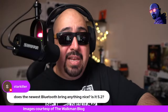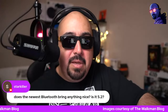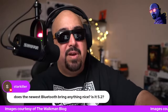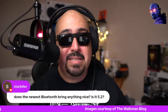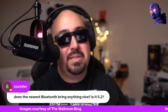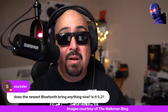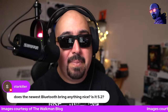Does the newest Bluetooth bring anything nice? Is it 5.2? Yeah, it's 5.2. Usually what you're getting out of it is better power efficiency. That's why a lot of the earbuds now that bring you 8, 9, 10, 11, 12, 13 hours of playback time are running Bluetooth 5.2. Some of the newer Qualcomm chipsets are getting much better power efficiency, like QCC3040 and better are getting some serious battery life.